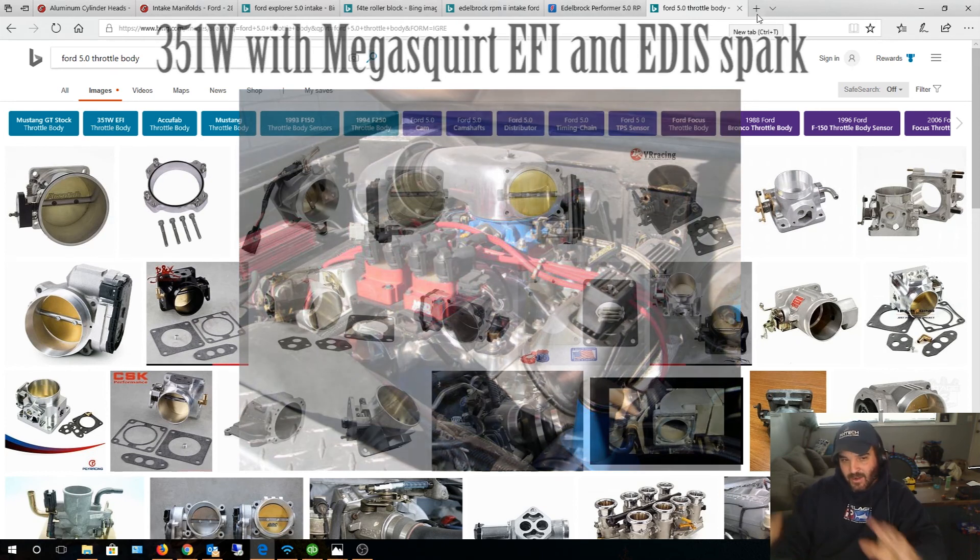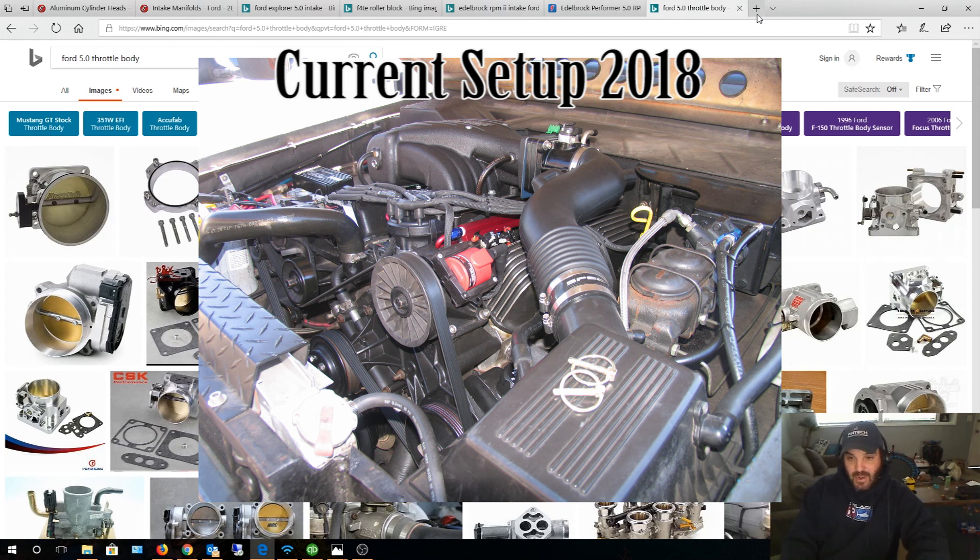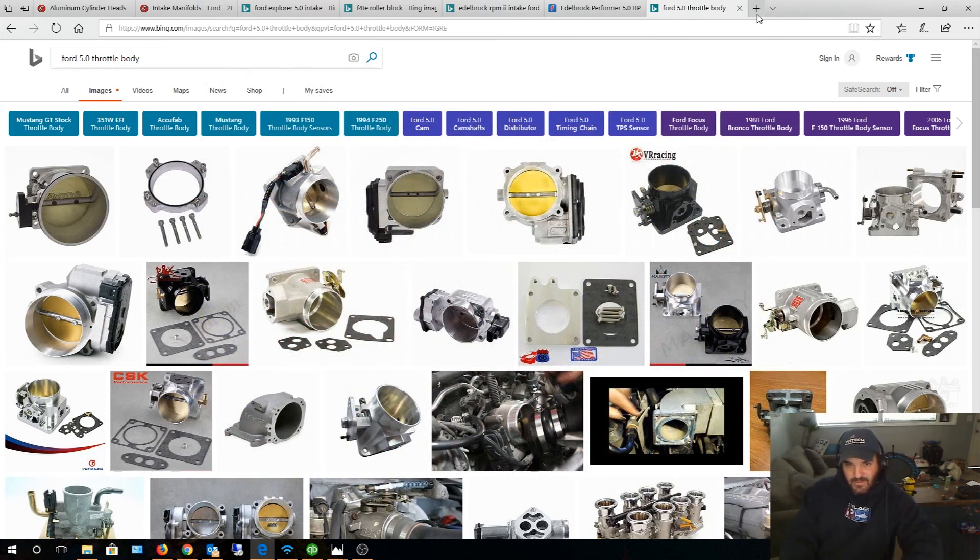The last thing I'll talk about is the torque converter. I've tried many different torque converters — I think three or four. Surprisingly, the best was the stock torque converter or just slightly above stock, depending on your gear ratio. I'm running 4.10 gears with an AOD transmission, and even with the C4 I had the best luck with the stock converter. On trails you want it to lock up right away — if the converter is too loose you'll slip a lot and generate excess heat.